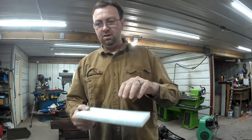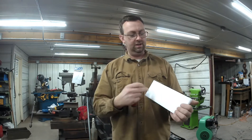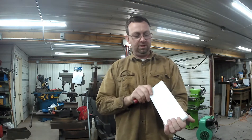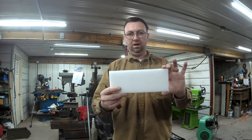Next we'll be drilling for the three bolts and countersinking for their heads on the back side. Then we're going to make a plate out of another piece of plastic — a different material we have left over — to go on the back side as a backer and as a way to attach it to the car body.